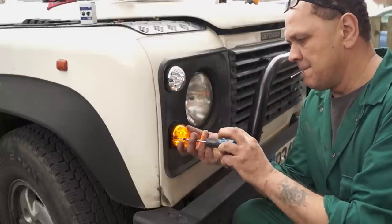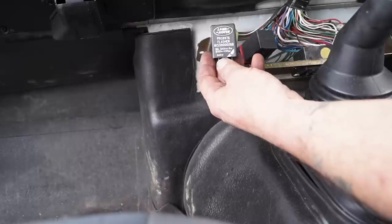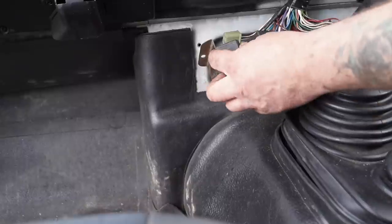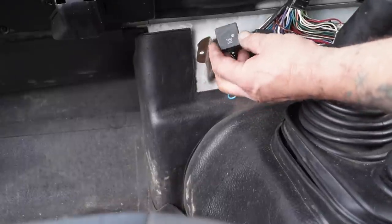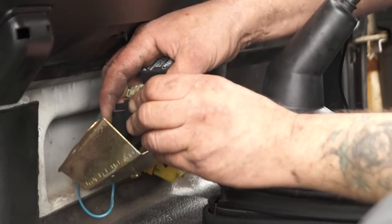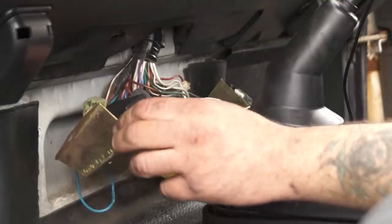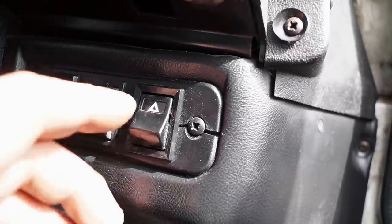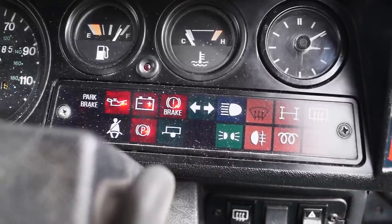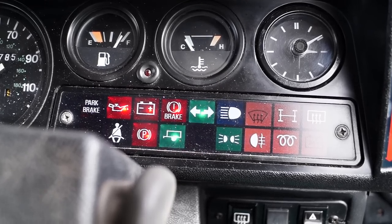We've got the last of the lamps fitted and I've left the four-way flashes on so I know that all of them are working before I go and change the relay. The relay looks like this and it will tell you it's a flasher unit. If you have trouble finding it, just put your four ways on and hold each relay — it will be clicking, and that is your indicator relay. I'll pull that out and push the new relay into place. I'd advise you check your hazard lamps operation — you'll see it should be indicating only on the trailer signal, which tells you your four ways are working. Also check your indicators left and right; they should show up correctly in the dashboard.